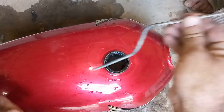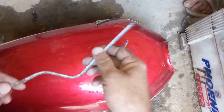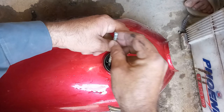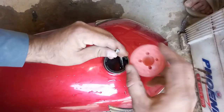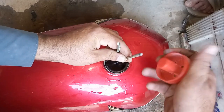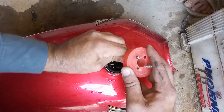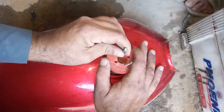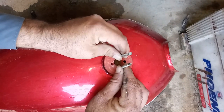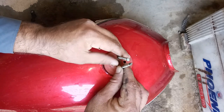I have shaped these steel rods so that they do not touch the tank metal surface. I have made a plastic cap that perfectly fits to the tank's mouth to hold these rods suspended in the solution. I have made tight holes in the plastic cap so that it keeps the rods suspended in the electrolyte. I need to make sure the steel rods are not touching the tank metal, so that current passes through the electrolyte solution.